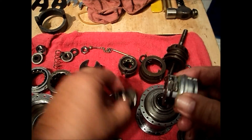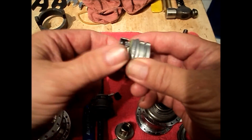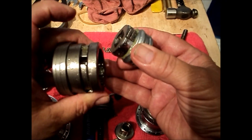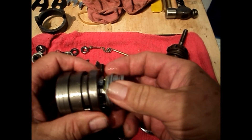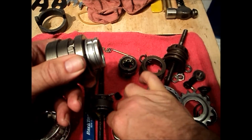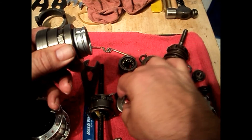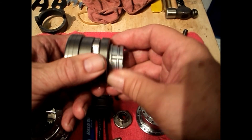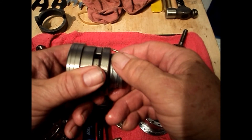In the event that third gear fails to engage properly, or if it slips out of third gear, these pawls are still driving the ring gear. So at the very least, rather than freewheeling, you will only revert to second gear — it won't completely slip out of gear. Should the clutch fail to properly engage the planet pins for whatever reason, the pawls will still continue to drive the ring gear, and the ring gear pawls will drive the hub shell. So you will at least have second gear.